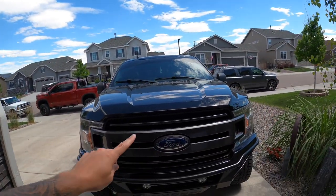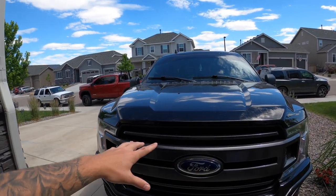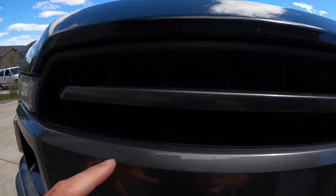So we're going to fix that problem today. I really don't know how to do this — I didn't look up how to do this. I'm making this video for you guys so you can change out your horn if you need to, if your low tone has gone out just like mine. First things first, I'm going to pop this hood because we're going to need access to it. The horns — right here, that's where the horns sit. It's only one bolt and then a plug, and we basically take it apart and put the new one in.